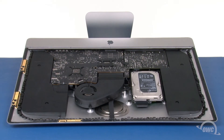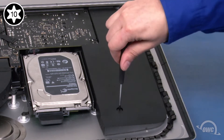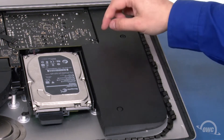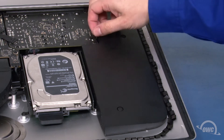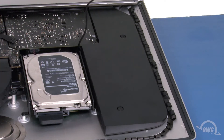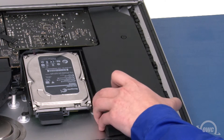To get at the back side of the logic board, we'll need to remove several pieces. First, we'll want to move the iMac's left speaker. Do this by loosening these two Torx T10 screws on the back side, then disconnecting the power button cable attached to the power board, and finally the speaker cable. You should now be able to move the speaker over and place the cable out of the way.